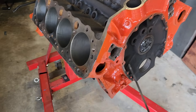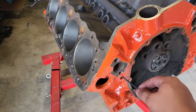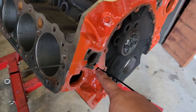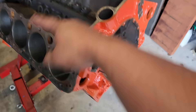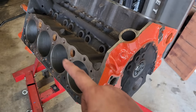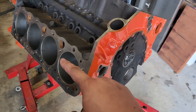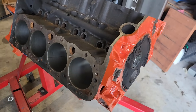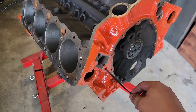If you're curious where that bypass goes, I'll put a zip tie into that third hole — it comes from the water pump bypass up to the cylinder head, then flows up and through the whole system in a nice loop. When you block that, you don't have that loop and the temperature in the head will get really hot. The block itself might read an okay temp, but the head will run very hot. If you're running an EFI system, that'll screw up your whole map. With a carburetor setup, you may not even notice.